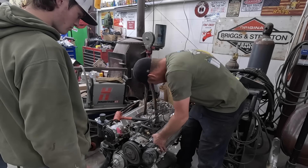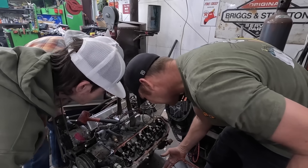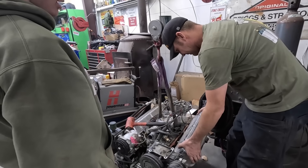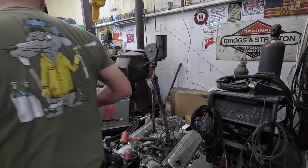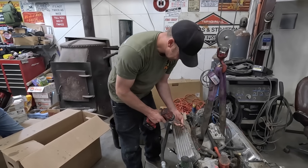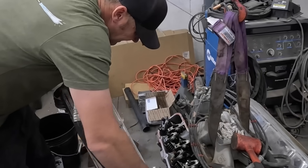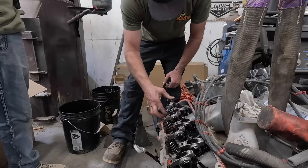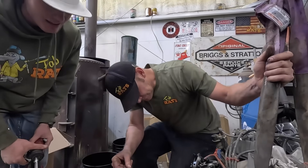That should pop loose I think. Maybe not. I don't see anything out of the ordinary. So it's off that side. It's not popping in there — it's huffing through the intake. Holy — oh yeah, there's the problem. Broke a freaking guide plate. Stuck a valve open. That is just insane.